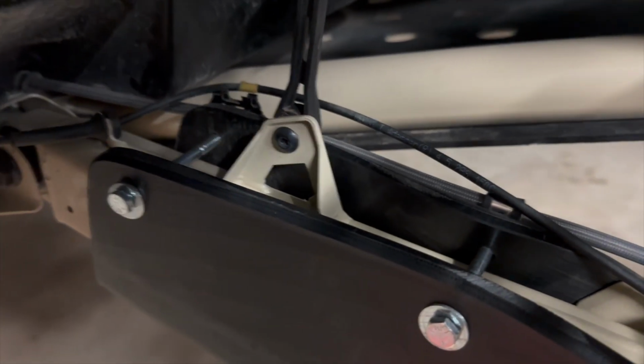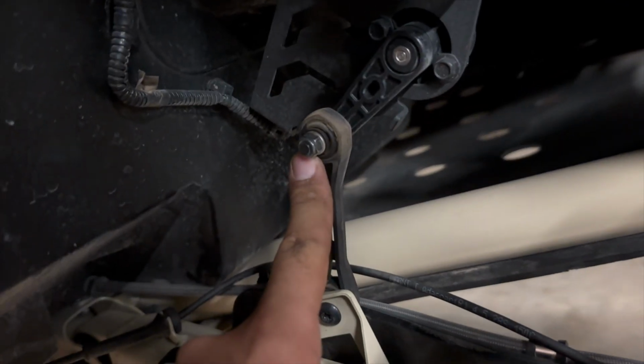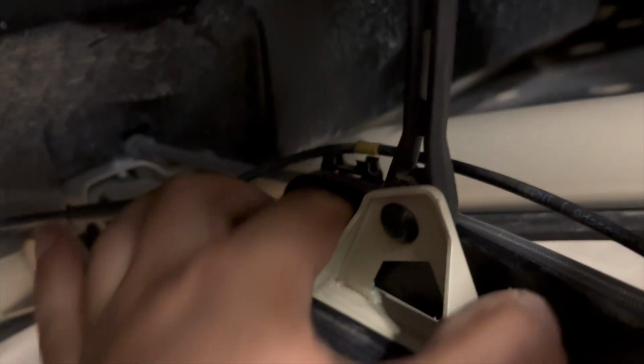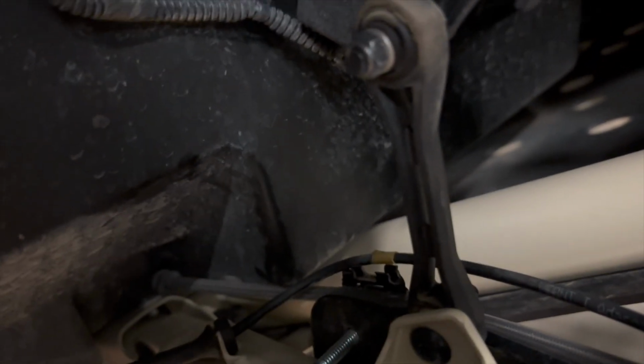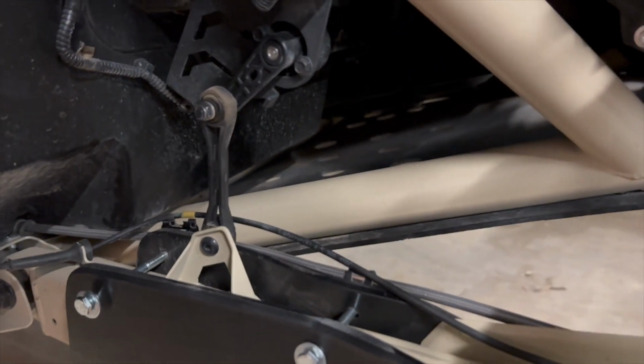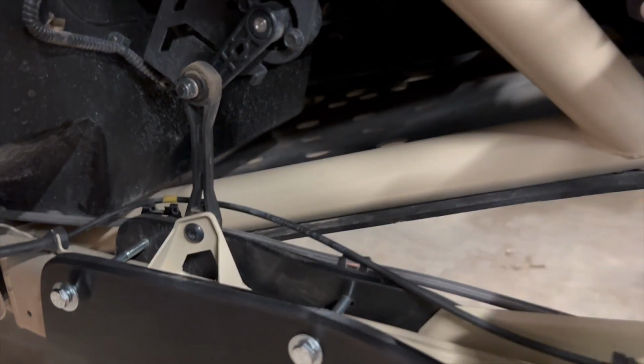So one issue I just noticed, and I don't know if this is my fault or they just don't make them yet, but the Smart Shock's sensor where the bracket is, it is actually pinning it into place. So we're going to have to notch it to accommodate full rotation, the pivoting of that sensor that actually gives the feedback to this Smart Shock system, and obviously adjusts it on the fly. So that's our eyes part of it.